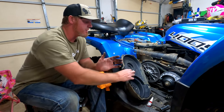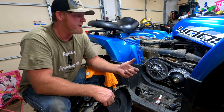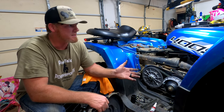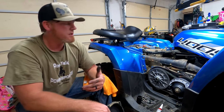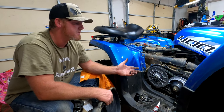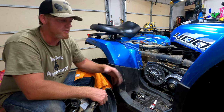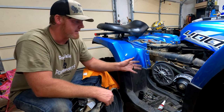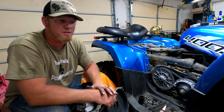Remember, this video was just to show you how to take your clutches once you have them off. If you want to see how to take the clutches off, I've already got a video posted that shows you — it's taking the clutches off the 800, but it applies to any of these CV Tech clutches on the CF Motos. Once you have them off, we showed you how to clean them — blow them out with air or use brake cleaner — replace the weights, and reclock your secondary. The secondary position will be different for different setups, rider sizes, and riding aggression.